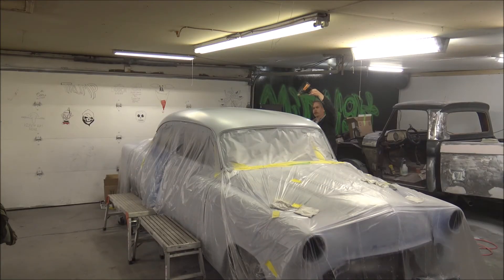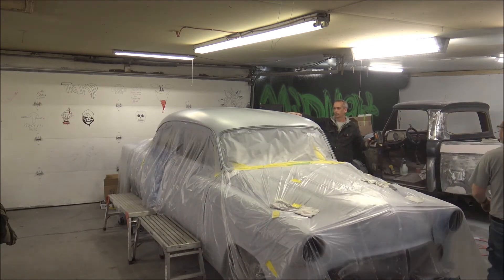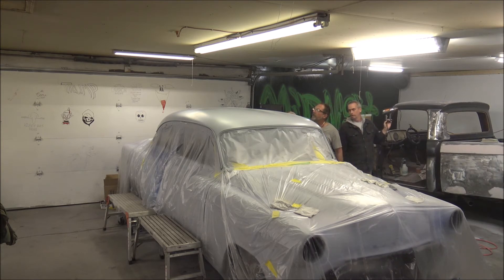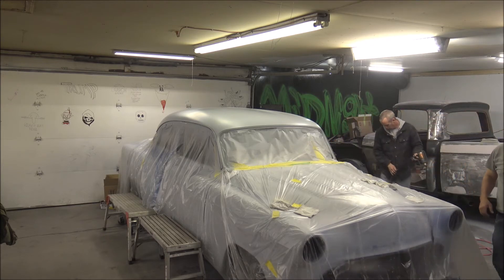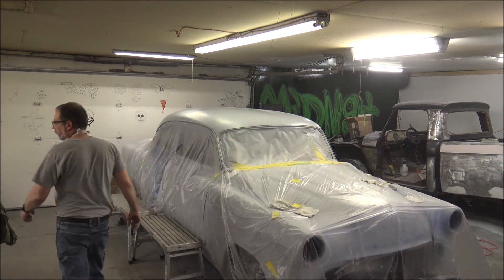Troy, do you want to explain what I'm doing right here? Drying paint. Instead of sitting here for four hours waiting for the little spot we got on here to dry, you can use a heat gun. Just don't want to overheat it. Because if you overheat it, it will cure faster than the surrounding area and you'll get wrinkles. So now just take a little 1000-grit over the top of it and lay it flat again. You can even take a little circular of 600 to knock it first, then 1000 to take the 600 scratch out, and you're done.